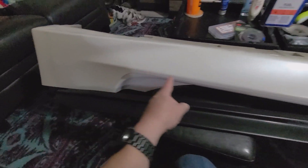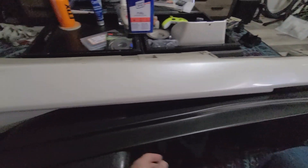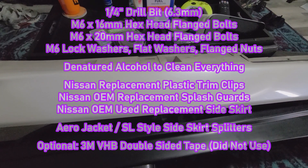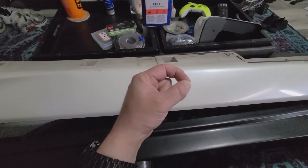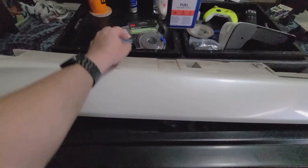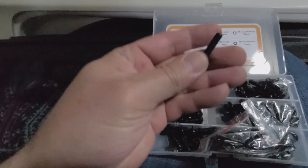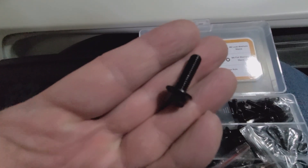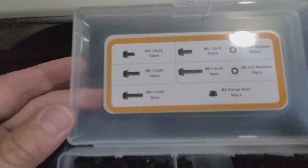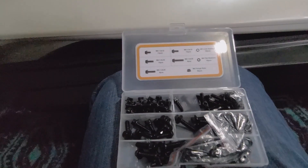We're inside where I've got my extra side skirt and I've pulled out the splitter that goes on there. This is all the equipment I'll be using. I'm going to test fit it up real quick, then use some double-sided wood clamps to hold down the plastic and the splitter to each other while I mark it and drill out the holes for these M6 screws. I'm probably going to use M6 by 20 with locking washers, regular washers, and flanged nuts to secure it to the side skirt.